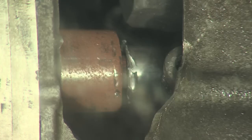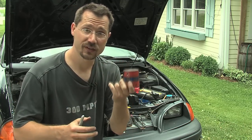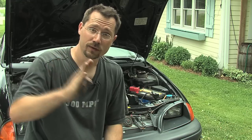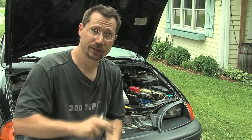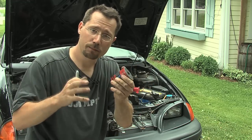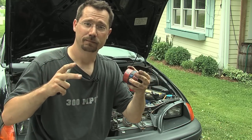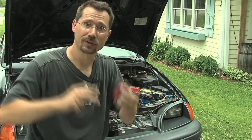Keep in mind I've still got neutral and all the gears in that transmission. Whether you do a two-part coupler or a single solid coupler, you're still going to have to take measurements, because you want the position of the electric motor, the thickness of the adapter plate, and the transmission to match up with the length of the drive shaft, the driven shaft, and the coupler — so that when everything's bolted together, the coupler can't slide around and both motor and transmission bolt together nicely.